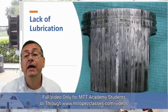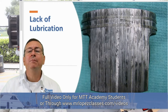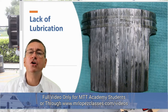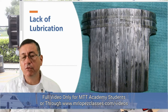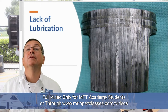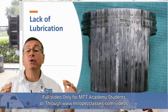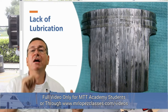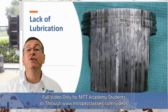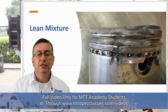Why? Because the oil is dirty or because people use additives. I don't recommend additives for modern oil. Be careful — never use additives, because additives act like a gel and when the temperature decreases, the gel clogs those cavities. Never use additives. This is the situation: lack of lubrication in one cylinder, and this is the final result.